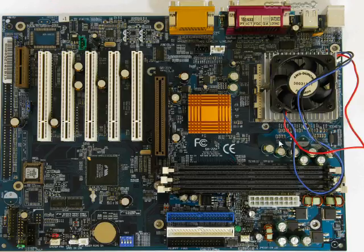And then you'll also want to map out where those screw holes are. Normally on an ATX-style motherboard, they'll pretty well be lined up in a kind of default configuration. But what I want to show you here is that we have a few along the side, some down here as well, 1, 2, 3 over here, and then a couple, 3 back here. They're not necessarily all in a straight line, because notice that these two don't line up, since you have to make room for these ports.